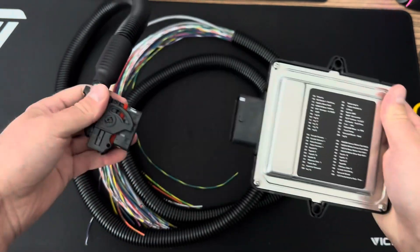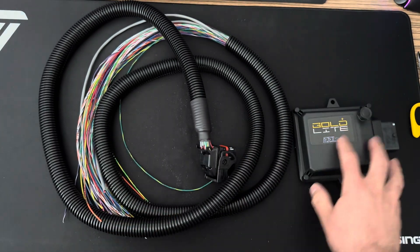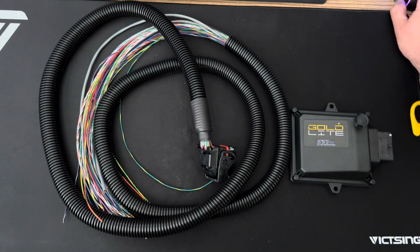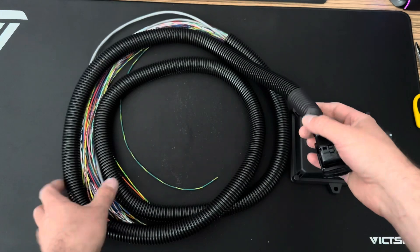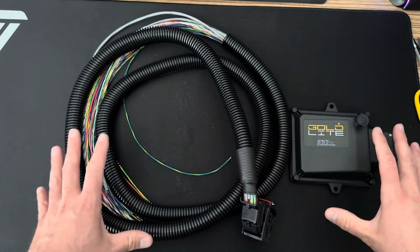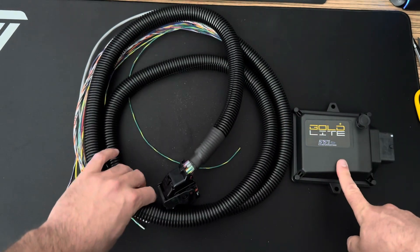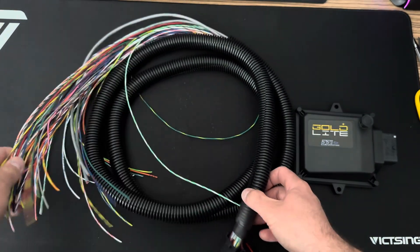For value for money, this is pretty incredible. They offer this for LS engines with a wiring harness for under a thousand dollars — on their website it shows an LSX plug-and-play for $980, or for $650 with an eight-foot harness you get the whole setup. You can rewire your entire car with an MS3 product and run sequential injection up to eight cylinders with all brand-new labeled wires.